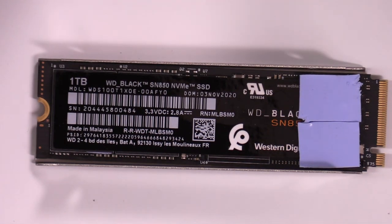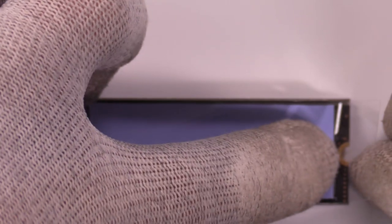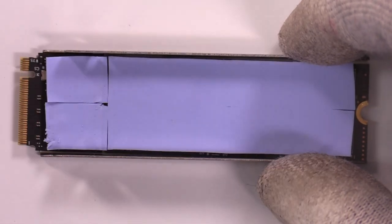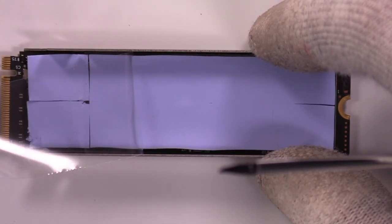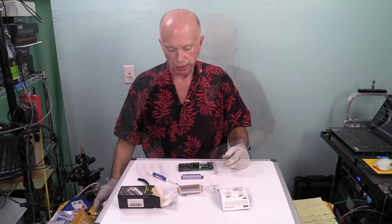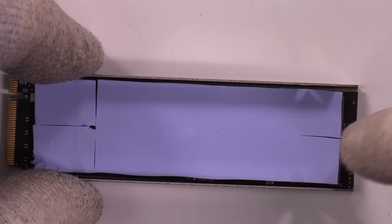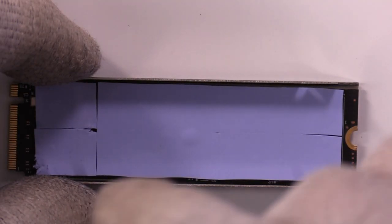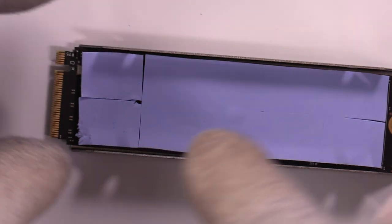I know that's supposed to be a feature, but I would prefer, and I will do that the way I did the bottom pad, after doing the first two, it's safer to put that down as one piece to get the full 2280. You can see how much neater that is compared to what I did with the individual pads. And then gingerly peel that top sheet off. Now, thermal pads are only supposed to be used once. And I'm surprised these vendors don't make allowances for how you can get thermal pads direct from them. Maybe they did, but I haven't seen it. So you can see kind of how that ended up. This is like building a model. So the best luck I had with that was peeling that off on one side, putting it down, and then peeling it up with that laying down. I get a more even distribution. Whereas the first two I did individually, I tore up the corner.